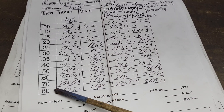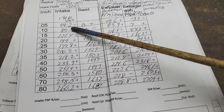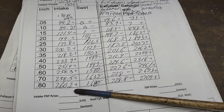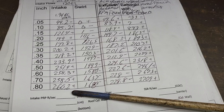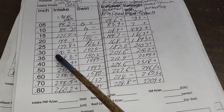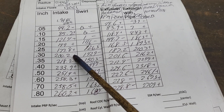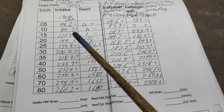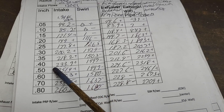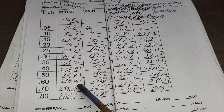Now this hits 260, and that head by itself only flows 270. So obviously I did something right with that manifold — it is an all-burr rough-textured manifold, works really well. Take a look at 300 lift: a lot of cylinder heads don't get to 200 by themselves, and we're doing that through a carburetor, through a manifold, through a cylinder head.